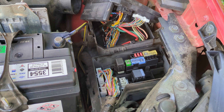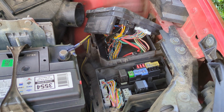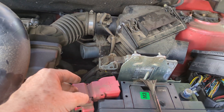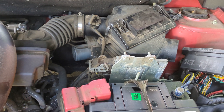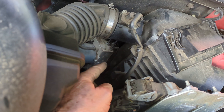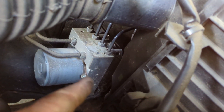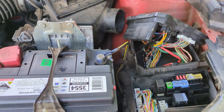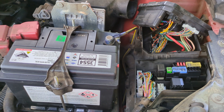We're not going to continue to drive it as-is, but at least I can drive it safely to a service place to try and get a replacement — one from a wreckers, maybe. I don't know if it's the motor itself. A lot of people said stuck relay, stuck contacts and stuff like that. Some people said the MOSFETs in the back, because there is a controller stuck to the back of it down in there — that could be failed. I should be able to get one from a wreckers, since this car is 14 years old.